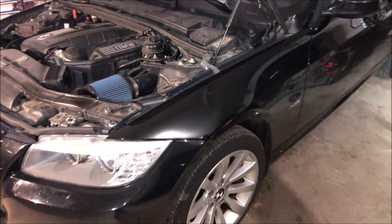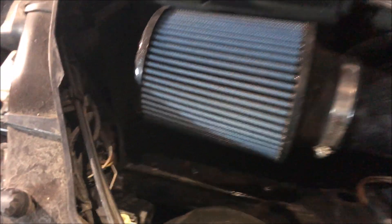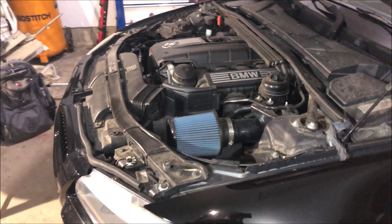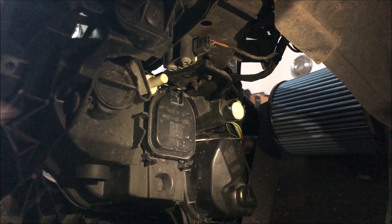The headlights in this car — there are multiple ways you can reach them from within the hood, but it's actually a lot easier if you go ahead and take off the wheel and the inner fender. Where we're trying to get to is right down in here. You could get your hands in there and fight it, but I find it's a lot easier to just take the time, pop the wheel off, pop the inner fender out, and you've got really easy access to all of it.